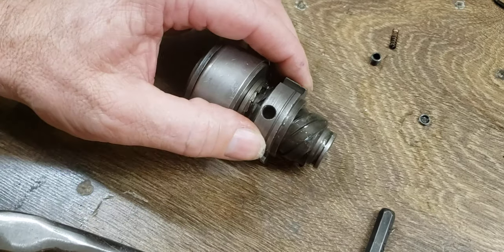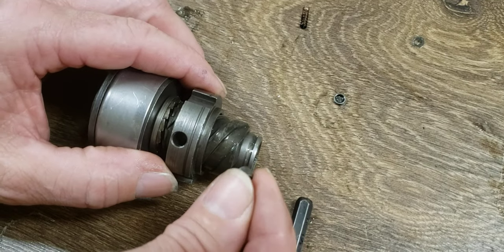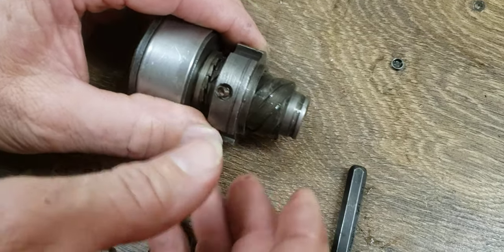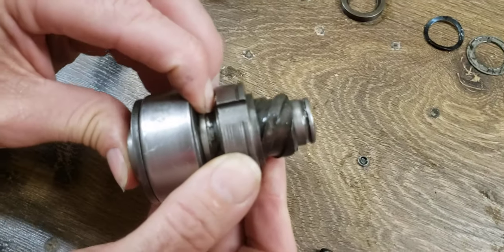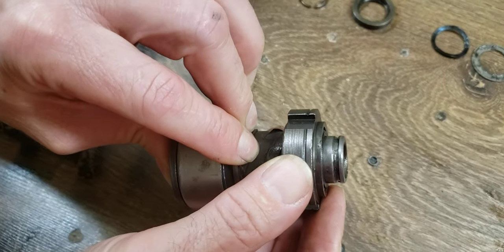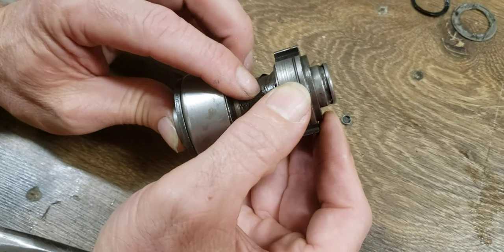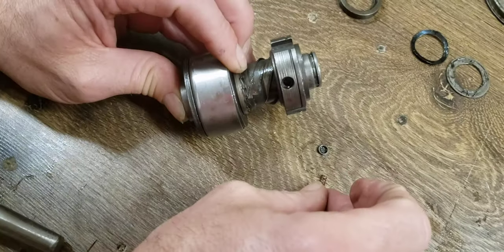Now that's not in all the way — we're not done yet. We're going to take the next plunger. Put it in there and make sure the cup's the right direction. Now we're going to simulate it — we're holding that down a little bit. This is coming out. The starter's engaging. The Bendix is engaged in the flywheel and you're going to hear it click. Do you hear it click? And it won't come back. That's the heartache that everybody has right there, and that's what's causing it — but it's as designed. Don't get a hammer and start slamming on it — you'll just ruin a starter that you probably can't hardly get parts for anymore.